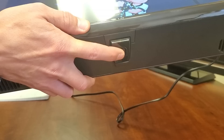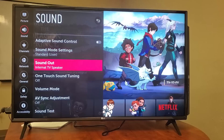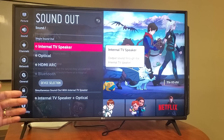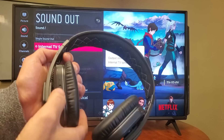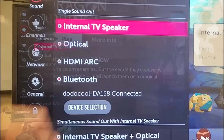Also on the bottom of the TV, right under the LG logo, there's a power button where you can control everything if you lose your remote. Now let me prove there's Bluetooth — go to Sound settings, move to the right, and it says 'Sound Out' which is currently on internal speaker. When I press enter, Bluetooth shows up but it's grayed out because you need to first pair a Bluetooth device. I hooked up my Bluetooth headphones, turned them on, and it asked me to pair them. Once I selected yes, the Bluetooth option is now in color.